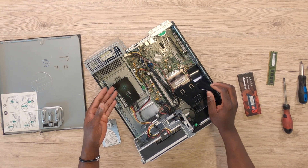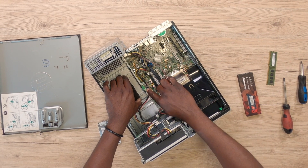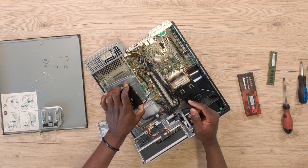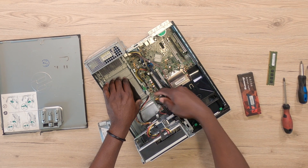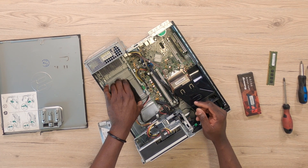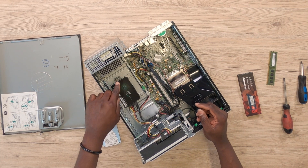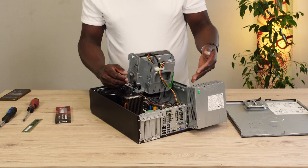The thing with the HP lock system is that to bring out the hard drive holder, you always have to depress the green lever right here — in this way your hard drive holder comes out. If you want to put it back in, you really do not have to depress the lever. You just drop the SSD holder right into the compartment and push it back in. You get a little click, which tells you that the hard drive holder is properly sitting in place.